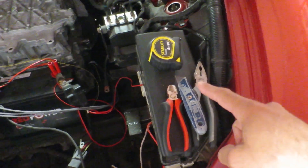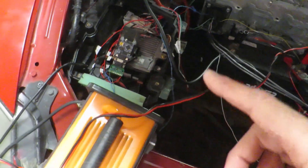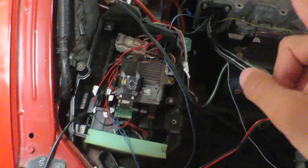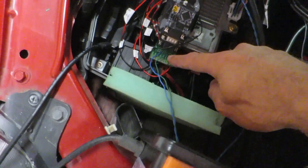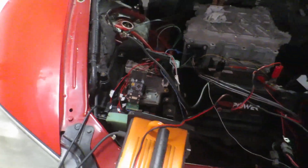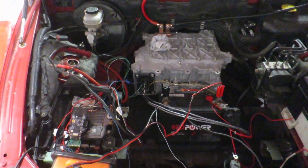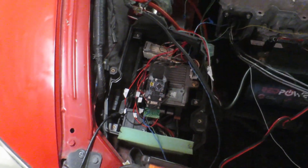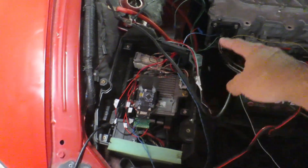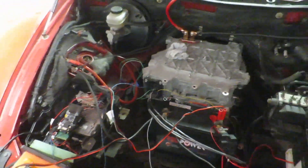Also very important — the Arduino that was controlling the inverter, I've merged with the code here on this Arduino, so this one is now doing everything. The CAN bus for the inverter I've temporarily soldered onto this header, which is then linked to the CAN bus of the RX8, so the inverter is now on the CAN bus — both at the same baud rate as the Mazda. This Arduino is now controlling the car, modulating the throttle pedal, and outputting that to the inverter, so I can control the inverter from the throttle pedal.